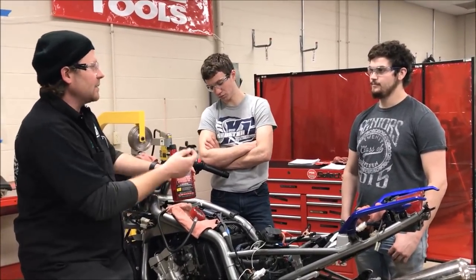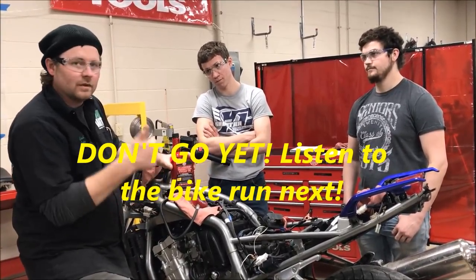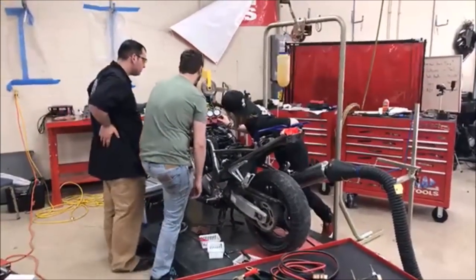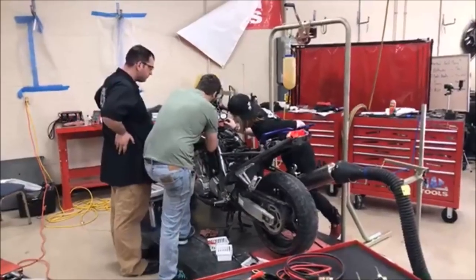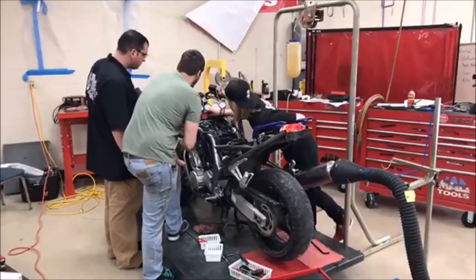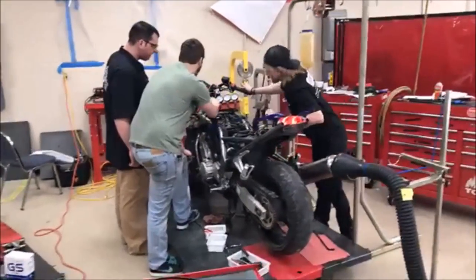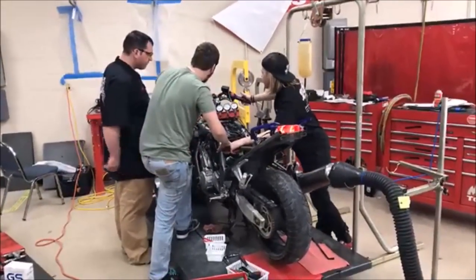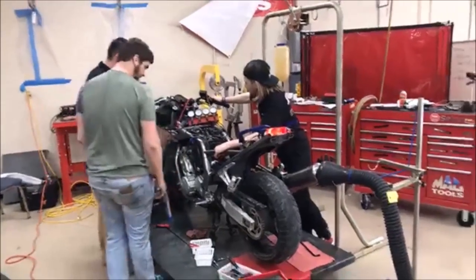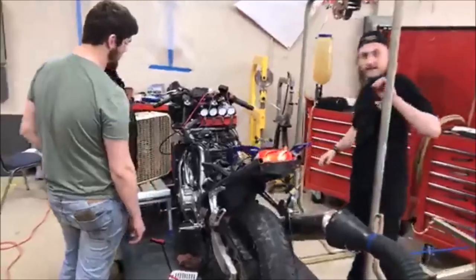This is just something we're trying to be proactive with on our time. Amazing results — great job to Marvel Mystery Oil. We got all the compression numbers up to 180 to 200 or so. And you can see here they're practicing carb sync right now and they are killing it. We first got it running, doing some exhaust temps — we had two dead cylinders, had to fix a no-spark issue on two cylinders, got the spark, and now we've got it running all four. The owner is going to be super stoked about this.